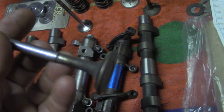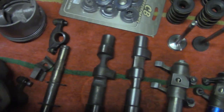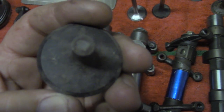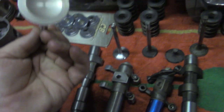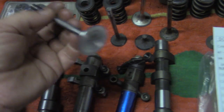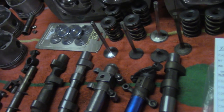We never know how much temperature has been on the stem. Here's a broken stainless steel valve — so they do break occasionally. The factory valve is actually a two-piece valve and the stainless steel valve is a one piece. A lot of times I'll upgrade to stainless steel depending on what kind of spring I put on the head, and that really depends on the budget and what kind of cam you're going to run. This is a Volkswagen valve that's been refaced and will be back in service — you want to inspect the stem and make sure it doesn't have excessive wear, take it somewhere that can reface them, and you should be able to use your intake valve over.